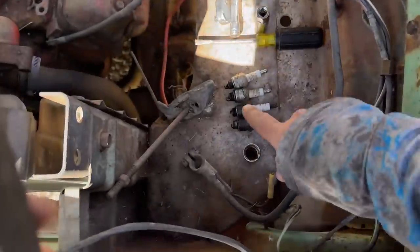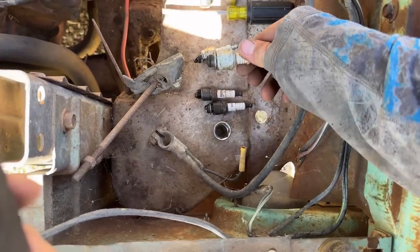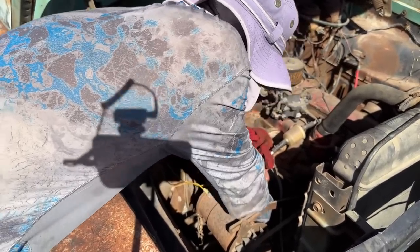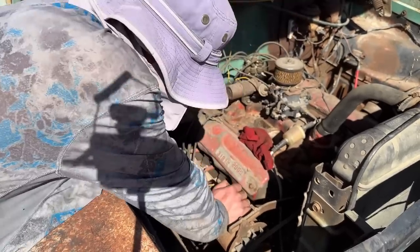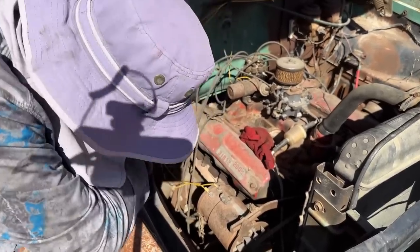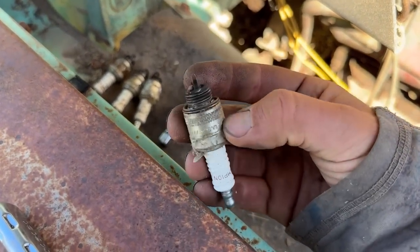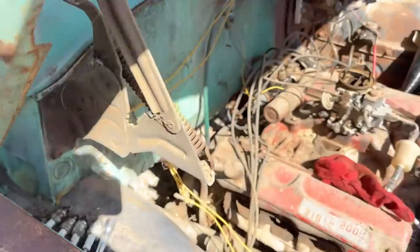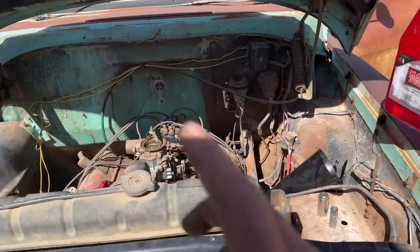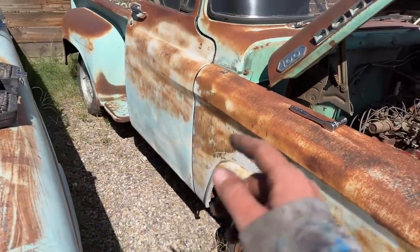I got the spark plugs out of this side. Two different kinds of spark plugs - they might have cross-threaded it a little bit, but it didn't come out too hard. They look okay, they don't look terrible bad - they'll work. Got the spark plugs out on this side too. These are all the same. We only have two AutoLites; the rest are Champions. They're kind of black but they're not really that fouled out. I don't see rust on them. We got dad over here - he's going to put some Marvel in the cylinders. Dad crawled under and said the flywheel is open, so that's a better vantage point anyway. I'm going to go get a big pry bar.